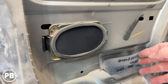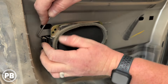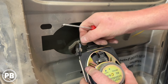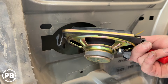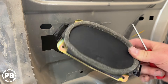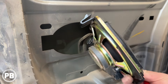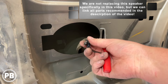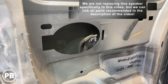Once that panel is off, here's your 4x6 inch speaker. It's the same similar design as the front where it clips on one side and there's a tab that locks into place on the other. It uses the same harness — the Metra 72-4568 will fit this plug — and we'll link in the description the parts needed.